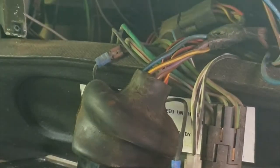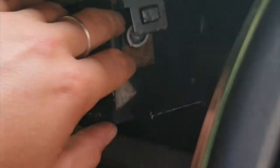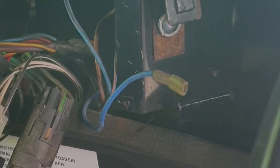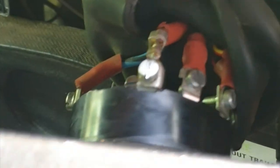So I thought I'd actually explain what I'm doing. I got a message back about the faults for the infrared switches — which are these here — which I had no idea about. As it turns out, they are quite prone to shorting and setting on fire. The infrared lights are military — in here we've got all the convoy modes for when they were literally driving in convoy and didn't want to be seen by the enemy. They had infrared lights which they'd turn on, put infrared goggles on, and you'd be able to see the vehicle in front while the enemy couldn't see you. Of course, the main problem is if the enemy also had the goggles. The issue today is them setting on fire, so I'm removing cables from terminal three and terminal five, then reinstalling the blue one onto the big six-way switch in the middle.